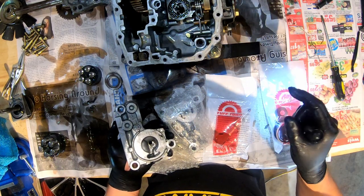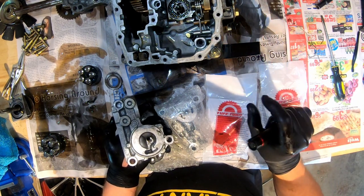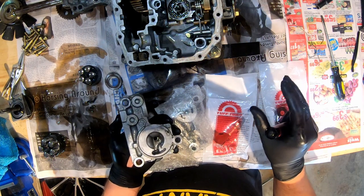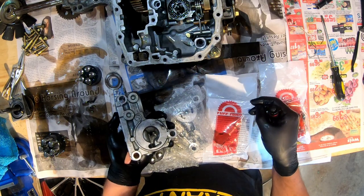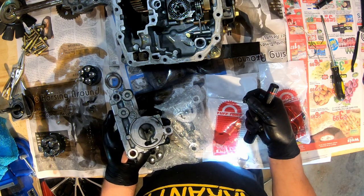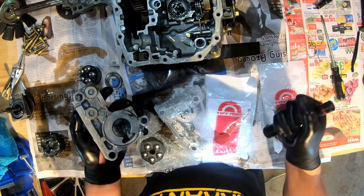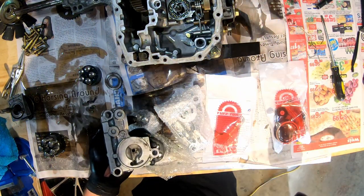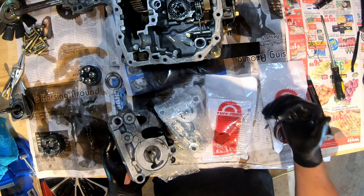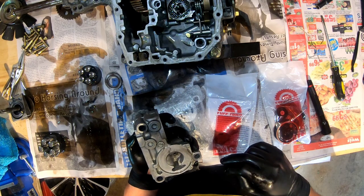Used to be, driving at 50 miles an hour, there's some definite play on center in the wheel, where now you do that and it's just a little bit better, there isn't any actual play anymore. None of the parts individually were bad, really. If you check them all, however you would go around with a pry bar, check ball joints, shake the wheel for the tie rods, things like that, nothing really felt bad. But all of it together made for a sloppy front end. And that might be the kind of thing that we're dealing with here.